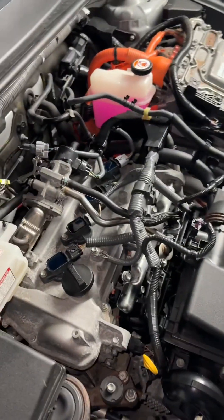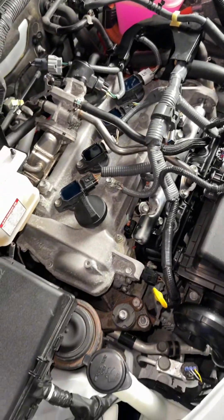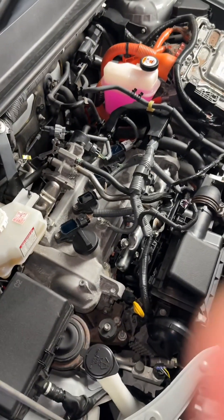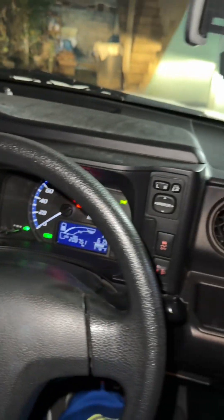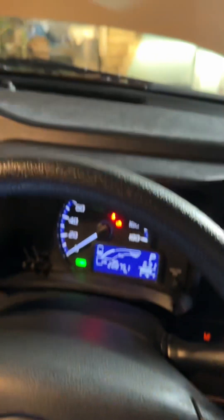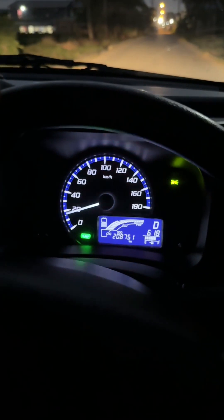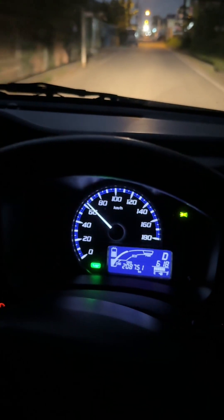That's normal, that totally happens — let's just wait until the system stabilizes and the fault codes should go completely. This is what I call a complete fuel injection service. Let's quickly check the idle. I think it's a little high, so let me give it a throttle body relearn with the scan tool — learning value reset. Look, she's idling perfectly now. Let's give it a quick acceleration — oh yes, it definitely feels stronger now.